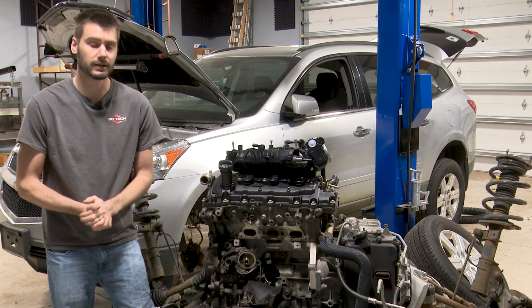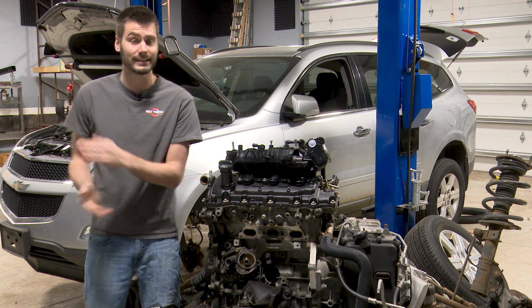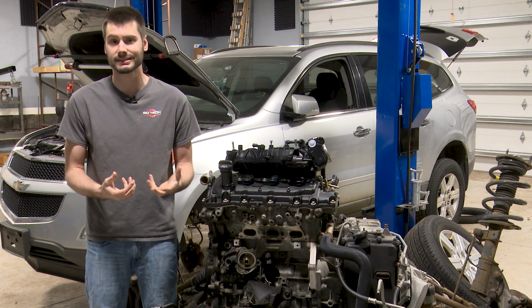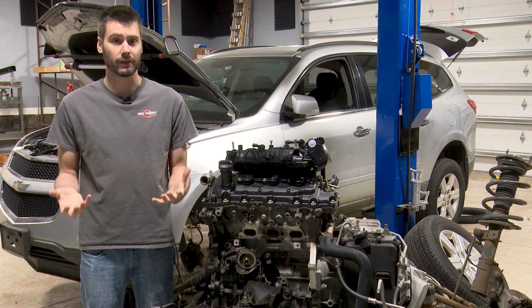So I'm thinking this is going to be a 3-part series. Part 1 here is get you guys up to speed, show you what's going on, show you the used engine that's over there, and then get it prepped for timing chain install. Part 2 is going to be the actual timing chain installation, chain guides, tensioners, that kind of thing. Getting that engine properly in time and showing you how to do all that.